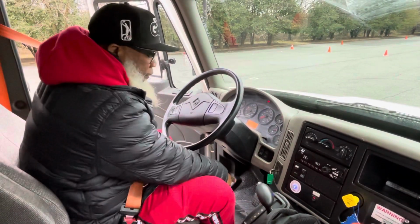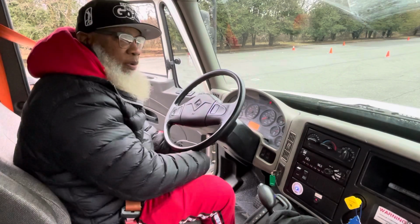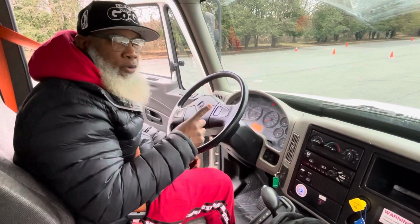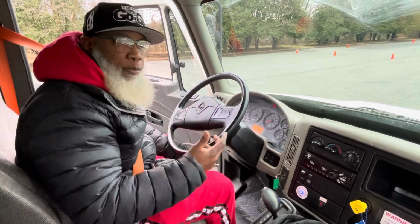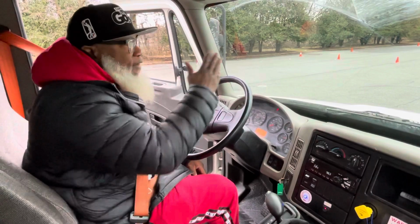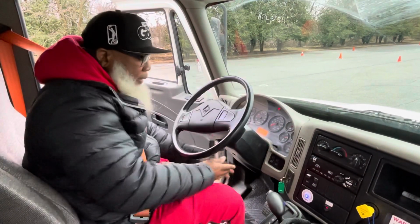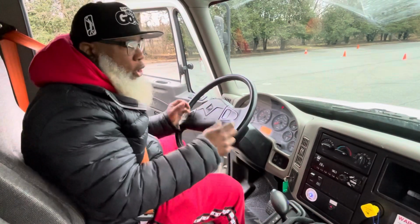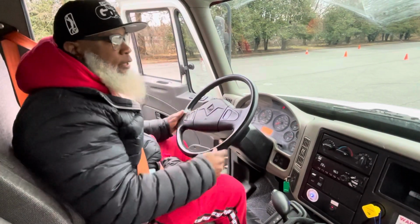Now explain the service brake test. For the service brake test, you don't have to perform it. You just have to say what you're going to do, or how you would perform it. So for the service brake test, I would drive 5 miles an hour forward, apply the brake, and it should not pull to the left or pull to the right. No unusual feeling. All right.